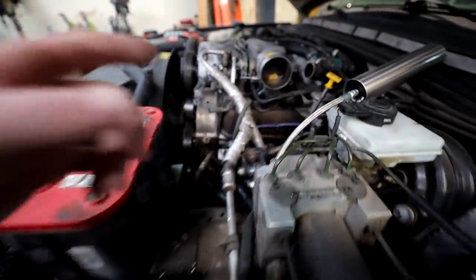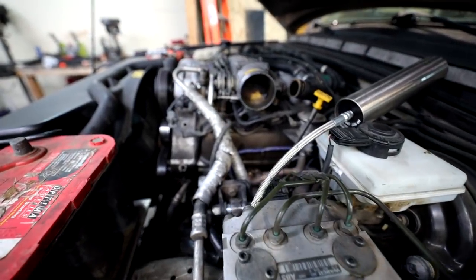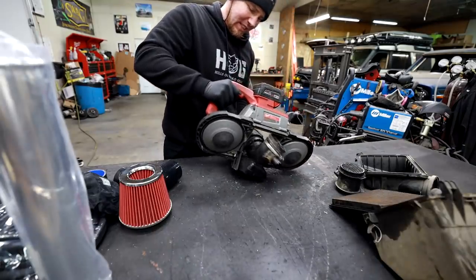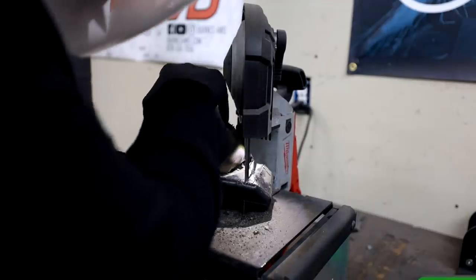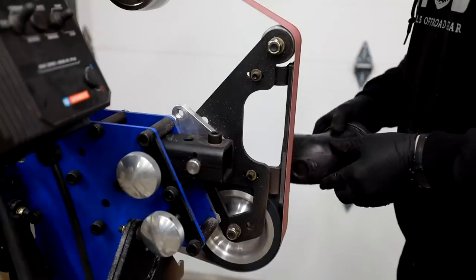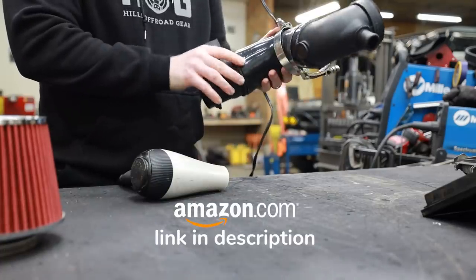The end goal is to make it so we don't have tons and tons of dust and dirt on the inside of our motor. I'm going to start by trimming up this factory intake pipe — the first thing I'm going to cut away is these silencing chambers put there from the factory to make the V8 not sound so much like a V8. Then I'm going to reroute the intake and adapt everything using parts I found on Amazon. I'll put a link to those Amazon parts in the description below.